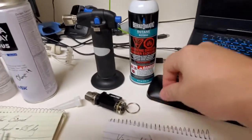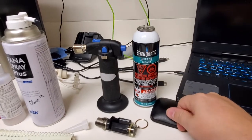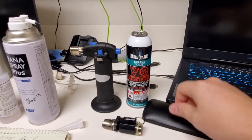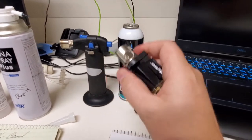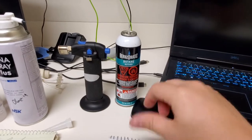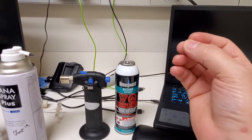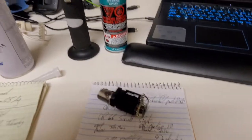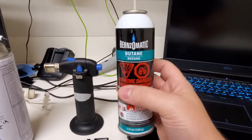I keep a mini torch in my toolkit all the time. Just yesterday morning I had a laboratory refrigerator where I needed to heat shrink some spade connectors and crimp connectors, and there was no place to hook up a soldering iron or hot air station — that's when this comes in handy. For heat shrink tube out in the field in a remote location, or to melt away something that's stripping out, or fuse poly rope so it doesn't fray — I cannot tell you how many times I've used a mini torch in the field.